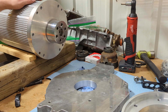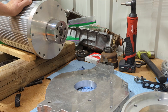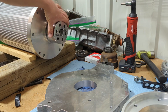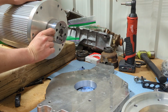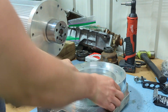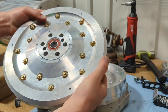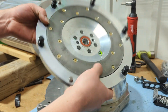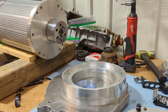What we have here is the Hyper 9 motor that we're going to use to power the Lotus Europa. I've already got my crankshaft adapter, which is going to hold my flywheel and clutch plate — it's basically just a cylinder machined down and drilled to my flywheel dimensions. I'm going to be using, believe it or not, a Toyota Yaris flywheel. It's almost the exact same size as the Europa because it's about an 8-inch disc and it fits inside the bell housing, so that's why I chose it.